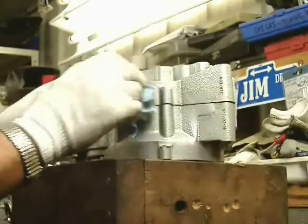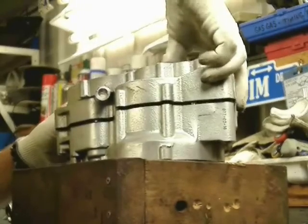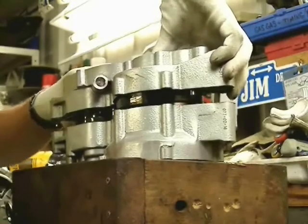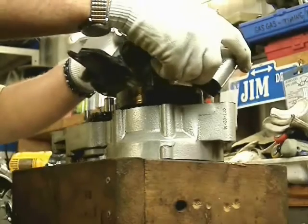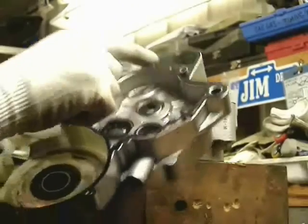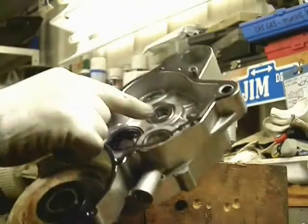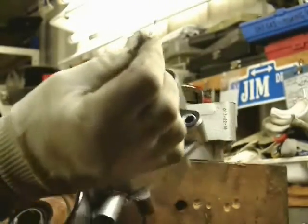We've got everything apart and all the bolts out. These center cases on the TRS are not difficult to separate — it's really amazing. You don't need to pry or beat on them; they just come off. But watch for washers that stick to the oil so you won't know where they go. Sure enough, a washer did stick inside the case to one of the bearings. There are also locating bushings on the center case and an aluminized center gasket. I found a washer stuck to the bearing, so I'm putting it back onto the transmission right where it goes.